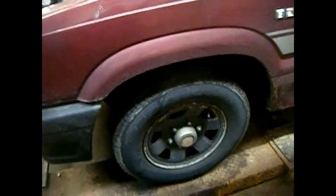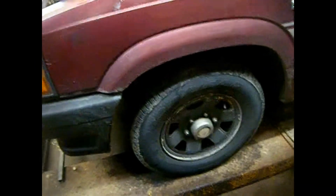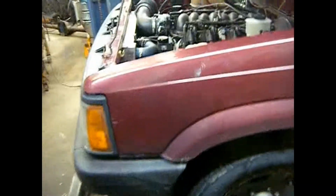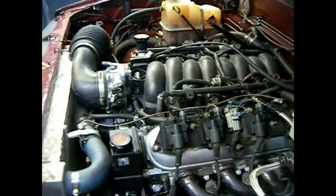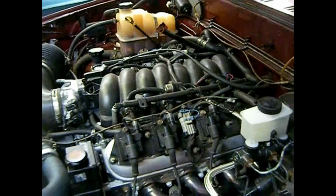And so the steering, I'm already looking. You may laugh when I mentioned before that we want to do some drifting. I'm already looking at making my own steering arms, increasing the steering angle as much as I can. I'm looking at putting bigger brakes on it all the way around. Obviously, it's going to get the 8.8 Explorer brakes in the rear. I'm going to try retrofitting some big rotors on the front.